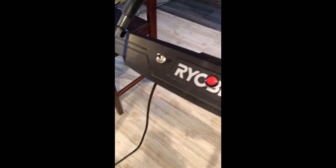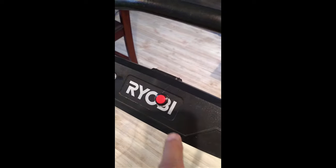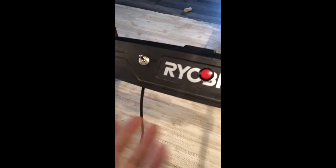Everything's installed and ready to go. I have my battery in and I have both the kill switch — which acts as the gray pull-down bar — and the momentary switch — which acts as the gray button — now activated. I took the gray handle off. To test: I hold down the momentary button and throw the switch, which is the same as pulling the handle backwards. To turn it off, I just throw the switch, which is the same as letting go of the gray handle.